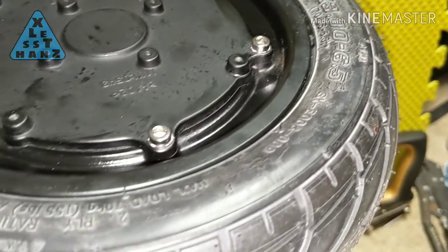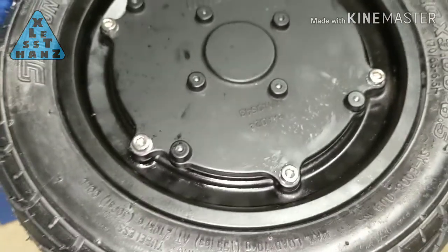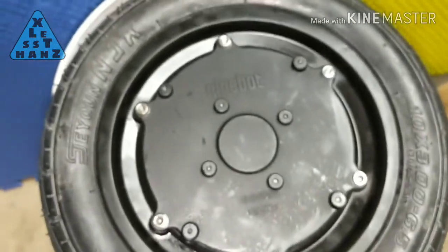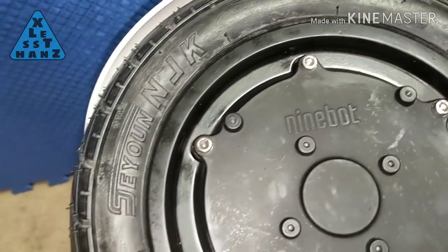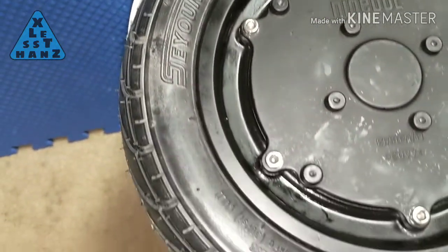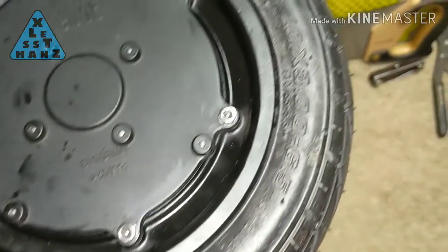To help limit this, push down on the tread of the tire to force the bead out to the rim while you attempt to inflate it. Limiting the opening in that one spot between the tire and the rim was enough to get things started, after which the air in the tire kept the bead against the rim for the rest of the process.